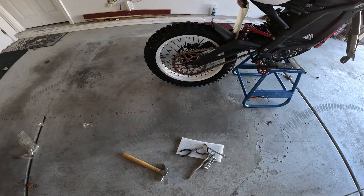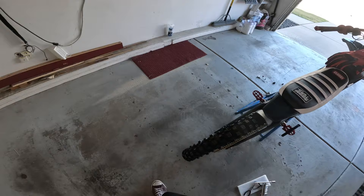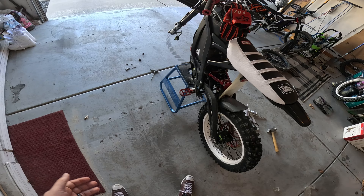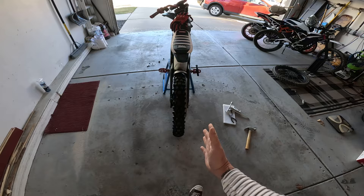We got the rear tire on. Funny thing is I thought something was wrong — it was making a weird noise and it turned out the kickstand was rubbing on the knobs. I'm going to have to take the kickstand off anyway; it's too short with this wheel set. I need to get a replacement kickstand and I forgot to order one, so note that it won't work. Also, I don't have to shave knobs because Milk Racing dished the wheel for me.